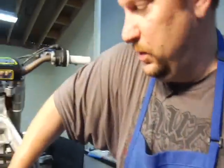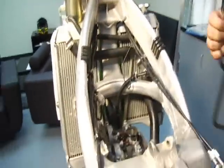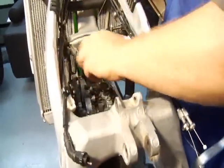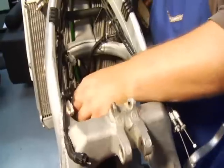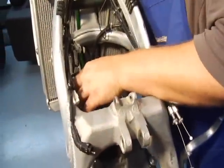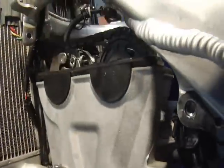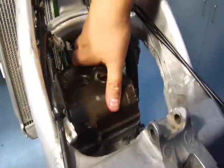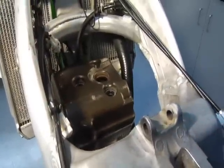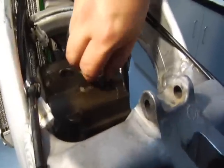All right, spark plug is in. Don't forget the spark plug cap. Fits on over top. We got a new gasket here. You can put a little bit of silicone on that gasket if you want to help it stay in place, but it finds a home pretty easy. Drop the valve cover on. And that's it. You've now done a top end on your 450 4-stroke.